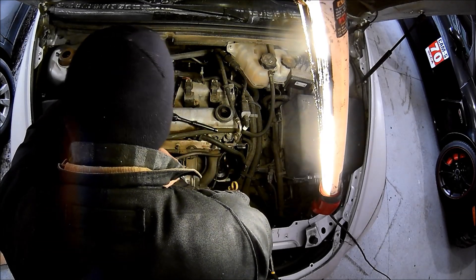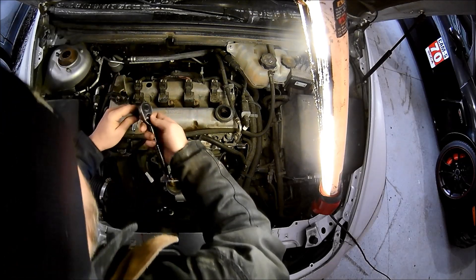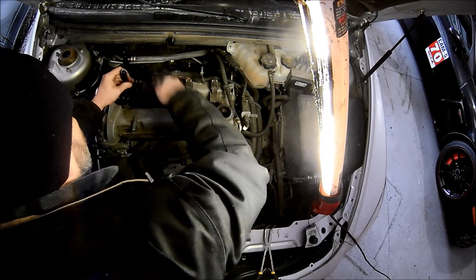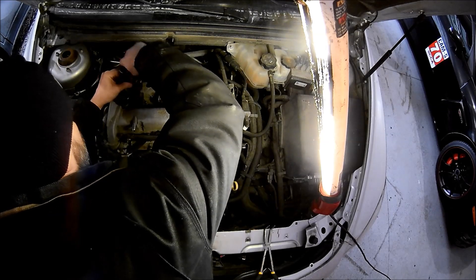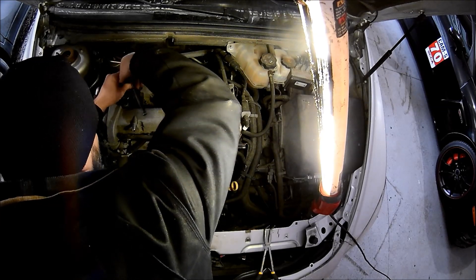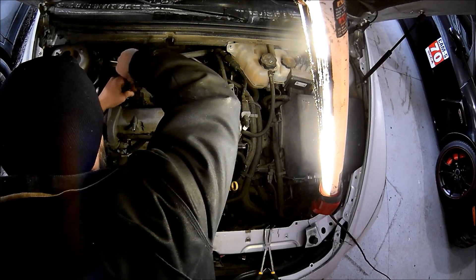One thing I want to say is when you put this back in, I'm not using an impact gun or even air power or an electric drill, because the threads are pretty fine. That valve cover holding it on can be kind of soft metal, so I like to hand-thread these in. The bolt will pull that cam sensor into place, so you won't feel any tension until that cam sensor starts to sink down in there.